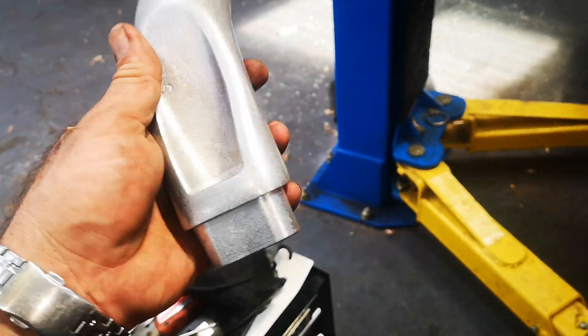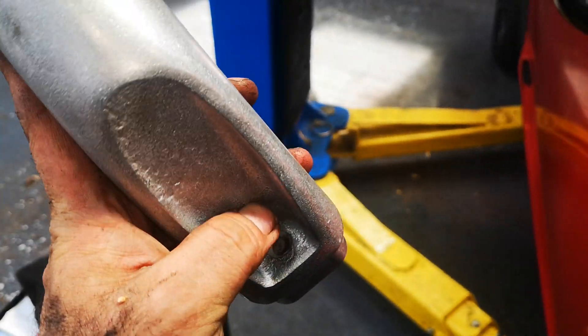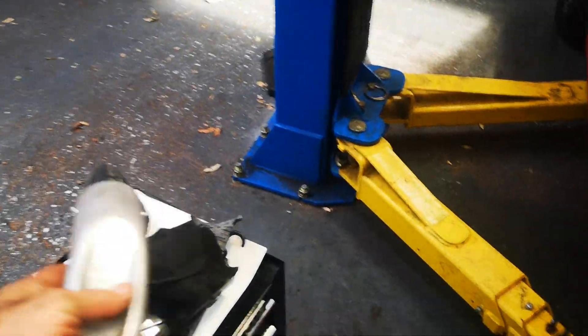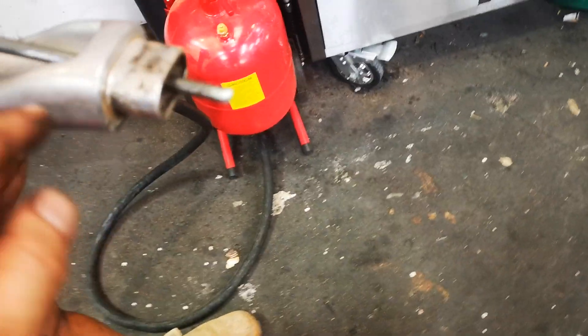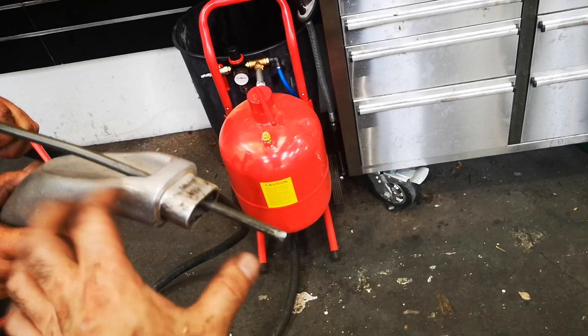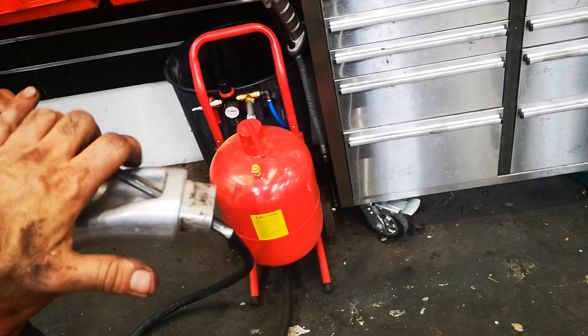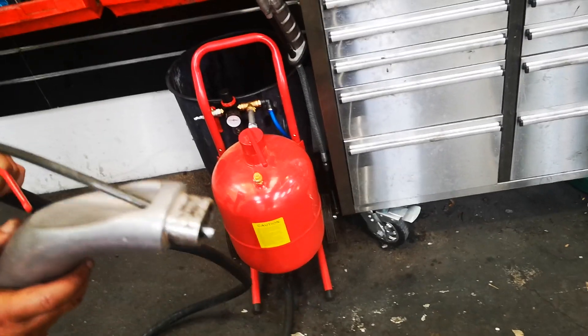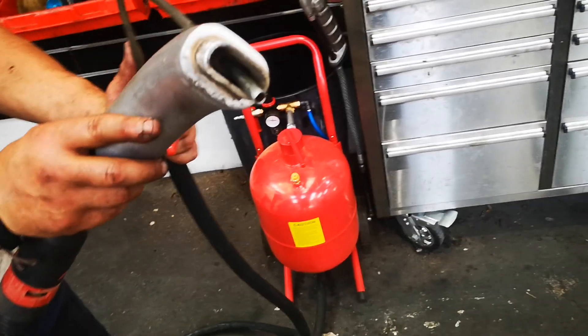It was more about moving the nozzle within the specific tool. This particular one is for the N55, but here's the Mini tool. You can't put the nozzle in too deep — hold it right up here and move between the two valves, because there's a divider between them. If you don't alternate, you will not get one of the valves clean.